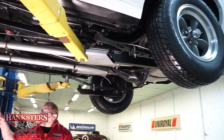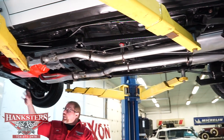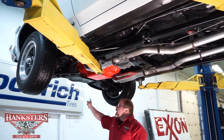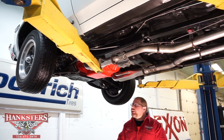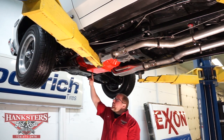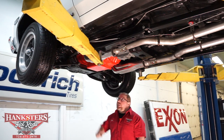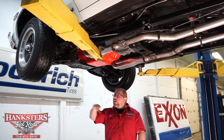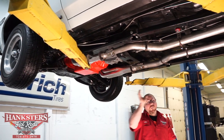Suspension is pretty much stock factory on this car — standard stamped steel lower control arms and upper A-arms, with ball joints all in great shape. There's a front sway bar with sway bar bushings at the frame and end links all in great shape. Steering components are all factory: power steering, drag link in the center, and tie rods all in great condition. The rubber dust boot covers are all intact and everything's been very well maintained. For brakes, it's a power brake car with disc brakes up front and drum brakes at the rear.